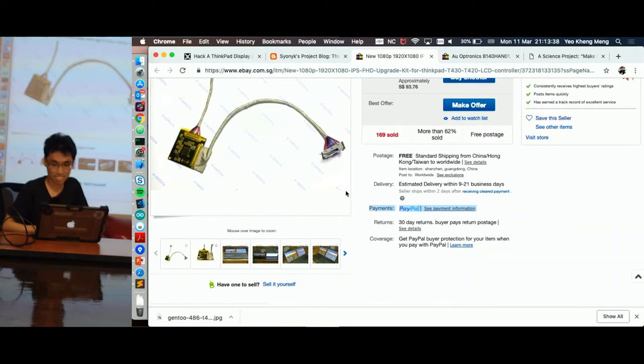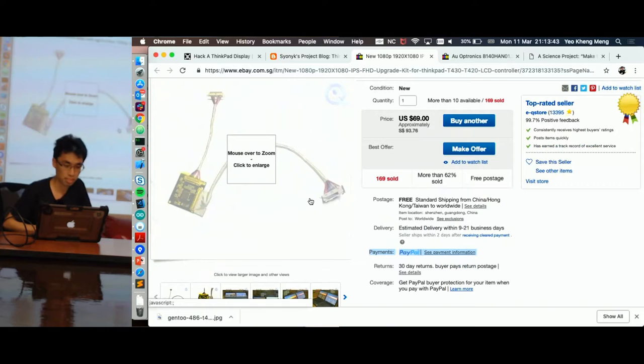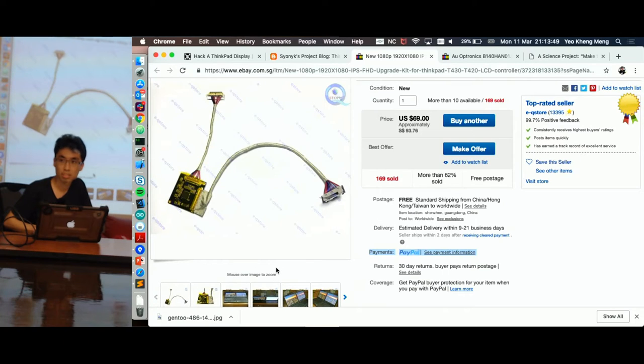So it's really a serial link that is very, very fast. Even in the embedded version, which tries to be more parallel, it's very high signaling. So we need a high-end FPGA. And the second is you need a compatible electrical interface, which the FPGA doesn't provide, so you probably want to have some extra interface.